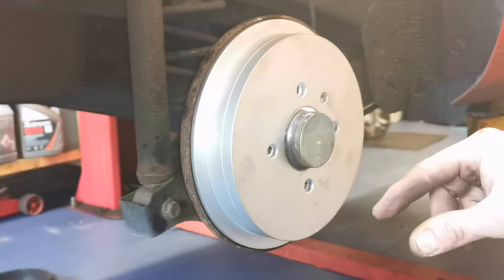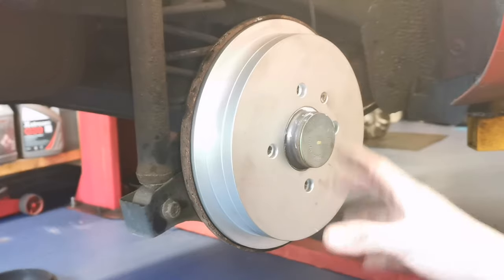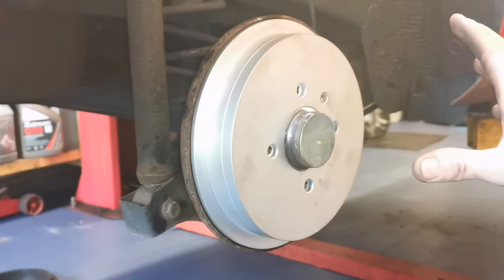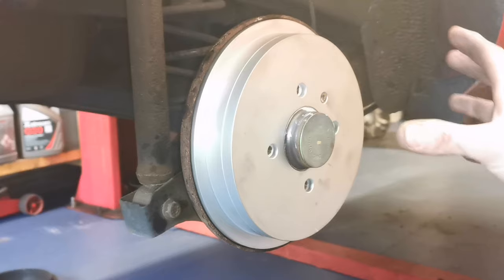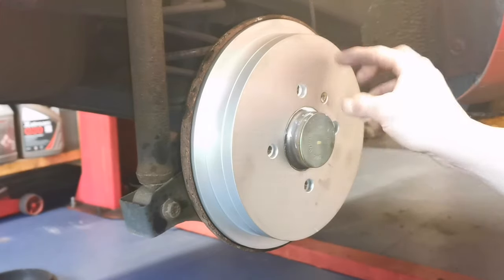So there you go. I hope you got something out of that. No pulling and hauling at springs at all. On this particular type of design - and I'm not saying all brake shoes are like this - some designs you do have to pull the springs in. But on Volkswagens, from my experience working on all the Volkswagen group cars - Skodas, Seats, Polos, all these small cars with drums at the back - they're all the same. They all use that sort of wedge style adjuster.